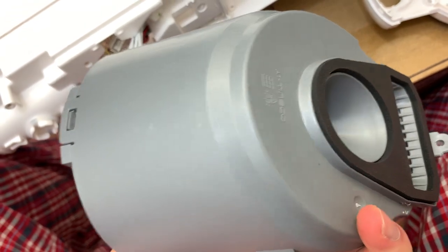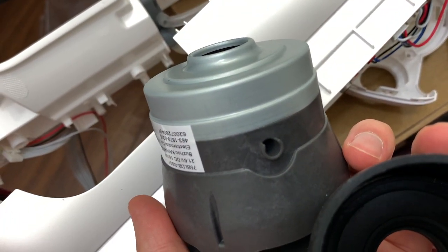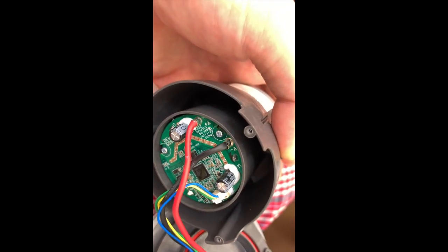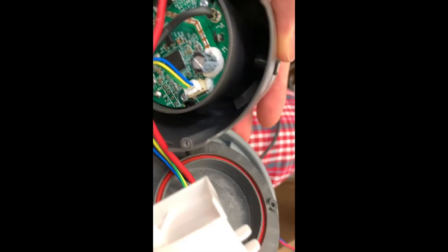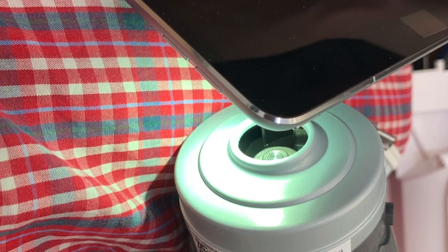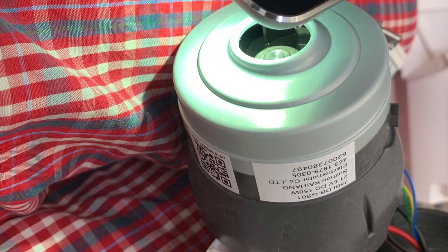Here's a polypropylene casing for the motor, probably to reduce noise. Inside there's a rubber sleeve with a duct to supply cooling air to the ventilation port on the side of the vacuum pump or fan. You can see the label on the motor — interestingly, the motor is only rated at 150 watts, as opposed to 220 watts on the label on the back of the unit. One way to explain that is probably the brush roller motor, which has to work against quite a lot of resistance, and also this does have a turbo mode so maybe it's exceeding the limits temporarily. Taking a closer look at the front of the fan, the impeller is a standard backwards-curved impeller, as opposed to a 3D turbocharger-style one like we see in Dyson. This motor does look quite similar to the Dyson digital motor with the exception of that impeller, but it works quite well despite being simple.